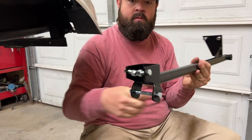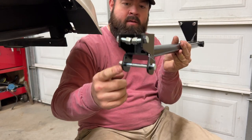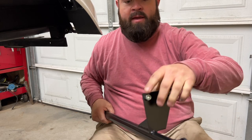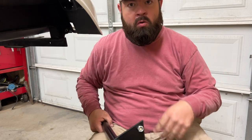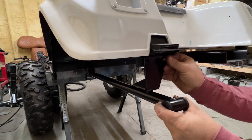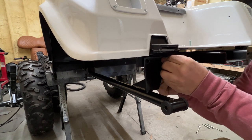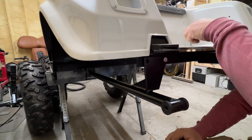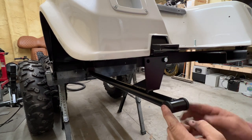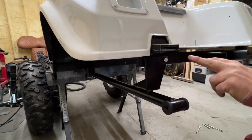This piece here is going to go between the mounts of the frame and get bolted to each side — that's going to be your new leaf spring hanger bolt, which drops it down and moves it back just a tad. On the back, we're going to need to drill some holes on the frame. Let me get the front bolted and I'll pick you back up in just a second. Once the front is mounted I think the back is going to do this here. I'll put the bolt in as well and the nut. On this one, I know we're going to have to drill one hole here and put the other hardware bolt and nut through there as well. This back bushing mount here lines up with the upper bushing mount, so it is in place.